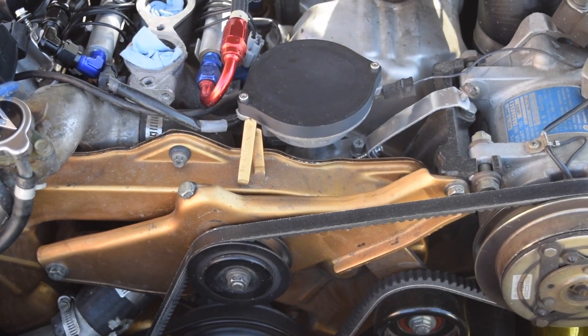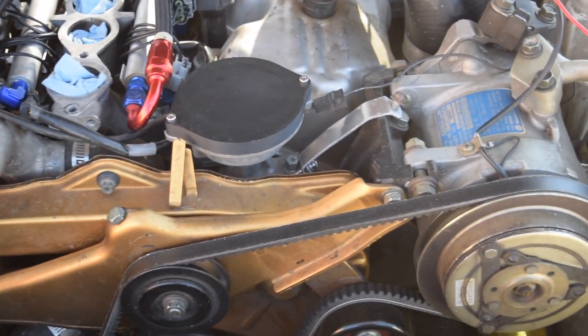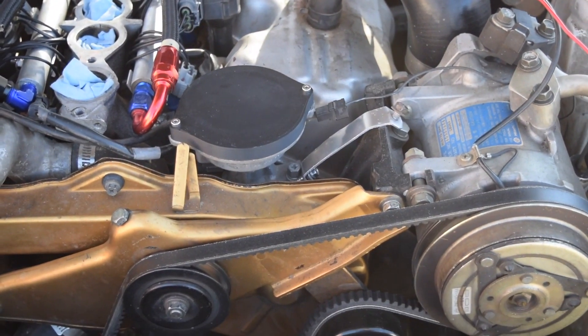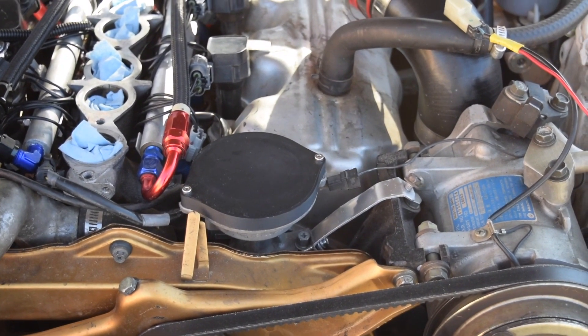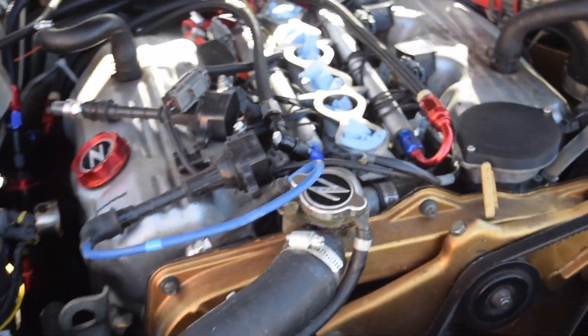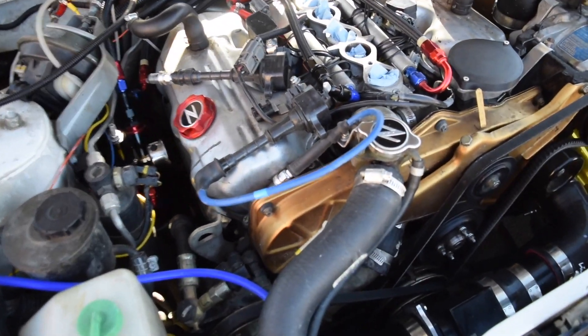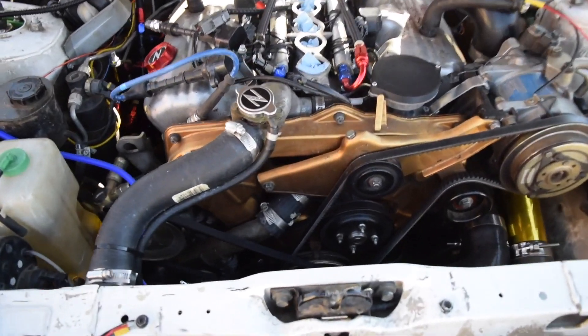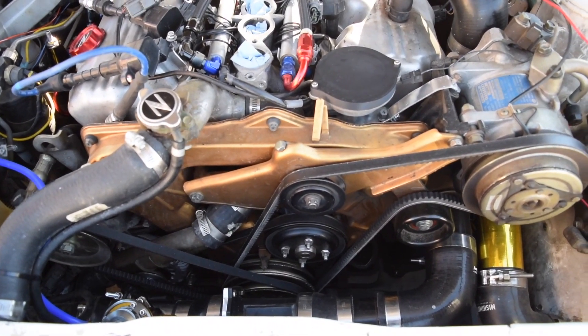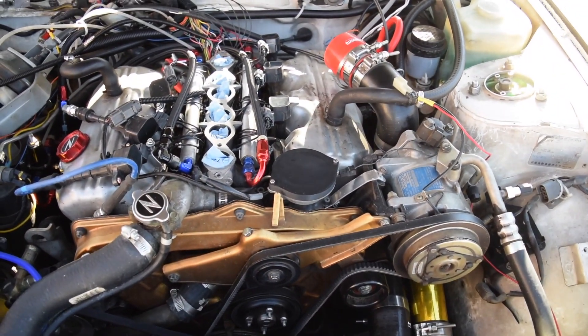We are really, really close to starting. One more thing about the crank angle sensor — we have to replace the crank angle sensor disc with a new one. It came with the kit; all you have to do is drop it in. I already recorded the video on that, so I'm going to play that clip now. I also have an old spark plug wire from the distributor with a spark plug in it for testing — we're going to go ahead and shove it down into spark plug number one so we can time this with an electronic timing light once everything is correctly set up.